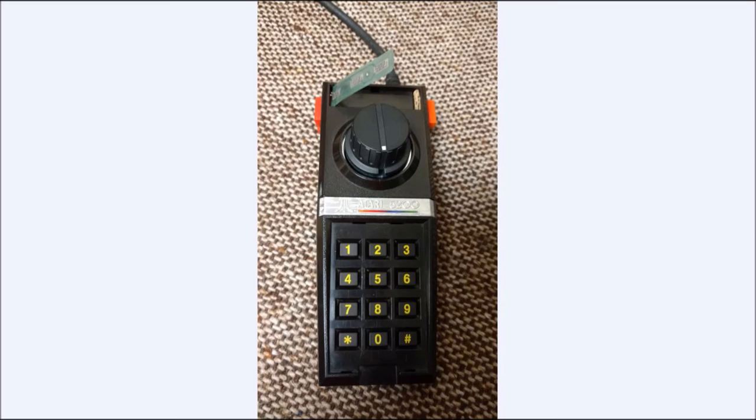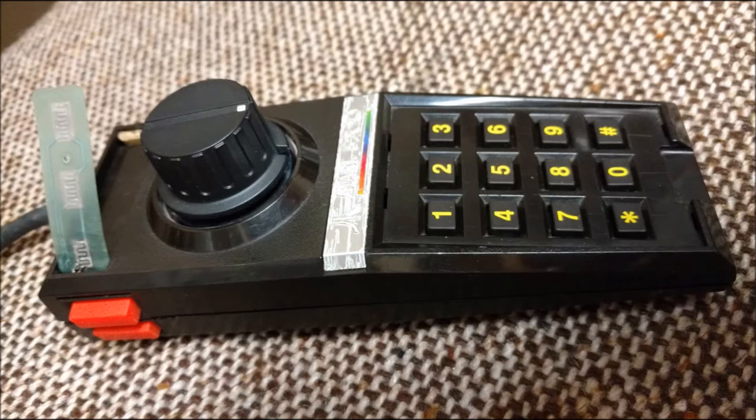Then you can basically put your controller back together. And before you put the screws in, I tested all the buttons and every one of these buttons were working. And the potentiometer is now working now that I put in the right one. The original time I put it together, I only had a 5K ohm, which was not sufficient, and I got no readings from it at all. But now this is a 1 mega ohm Radio Shack potentiometer, and it works really well.